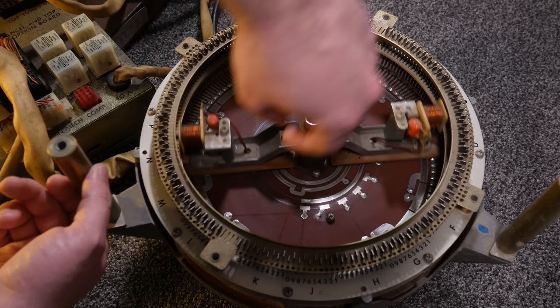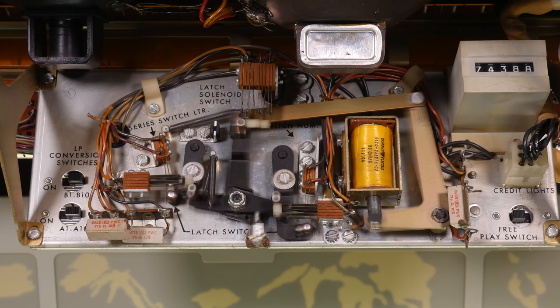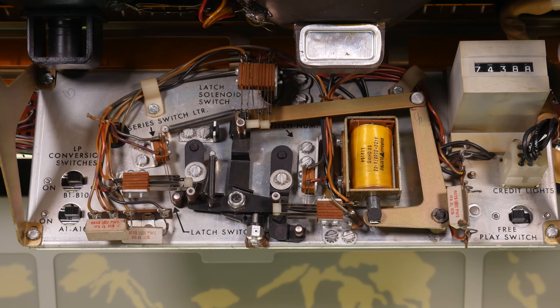That's happening because right before the selection accumulator gets back to its home position, one of those contact patches is sending power to a relay, which will flick off the power to the latch solenoid. I'm not sure because I don't have the schematics with me, but I believe the latch solenoid is wired through the normally closed contacts of a relay, and so if that relay gets pulsed briefly, it will actually lose power